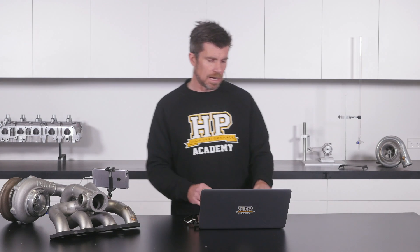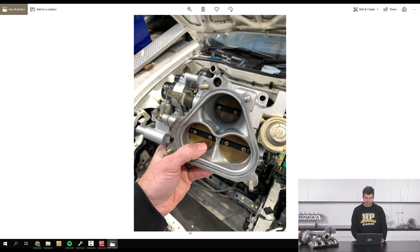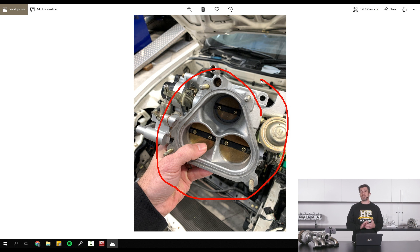As a result of some information we posted in our last pre-show, we got some comments on our YouTube channel about our drive-by-wire throttle conversion. This is a little bit problematic on the FD RX7 because of the design of the throttle body itself as well as the upper inlet manifold — it doesn't really lend itself well to easily adapting a normal off-the-shelf drive-by-wire throttle body from the likes of an LS2 or something similar. Let's head across to my laptop screen to show you what that looks like.